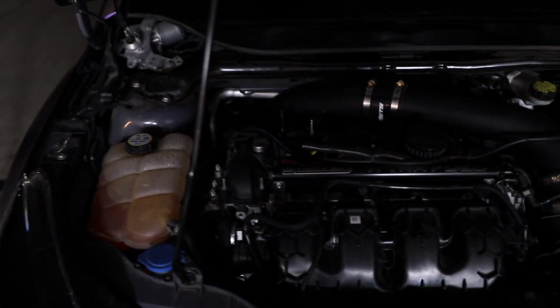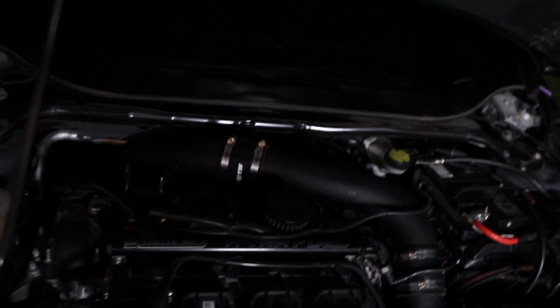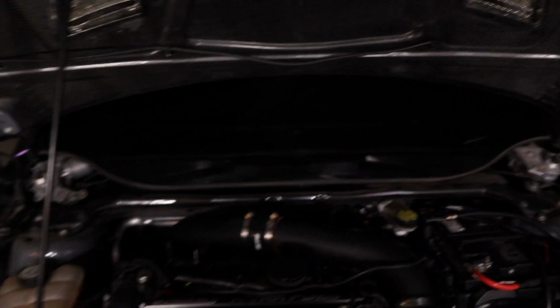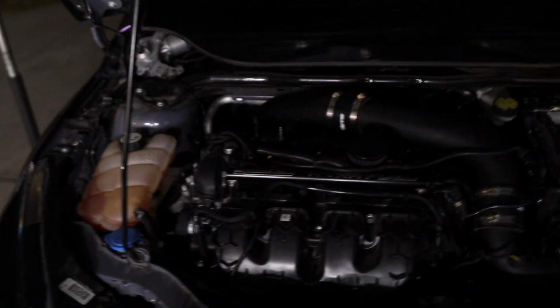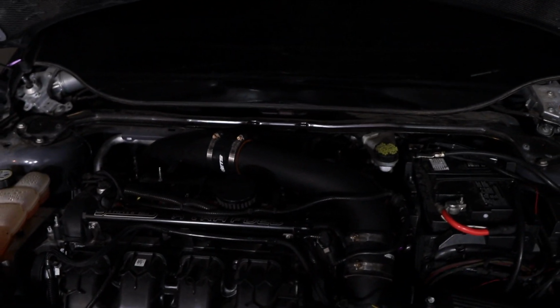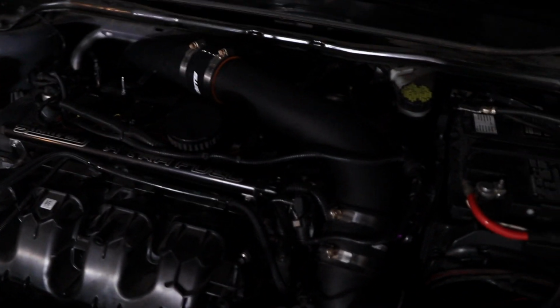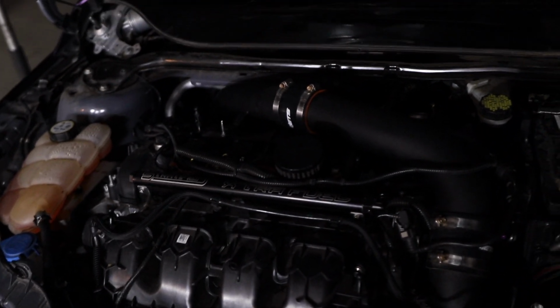Alright, so I got everything buttoned up on the front out here, everything except for the cowl. I got the intake back in place. I put the oil feed line back on, hoping that solves the issue. A piece of cardboard underneath, leaving it sit for a few minutes, then starting it and checking to see if there's any oil that's running through. I did add a little bit of oil because the leak was pretty significant, so I ordered 2 quarts of oil just in case I have to drive this thing to a shop in the morning and have the oil feed line done by a professional. Hopefully that's not the case, but we'll see.